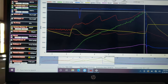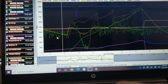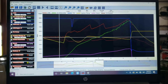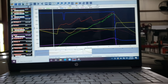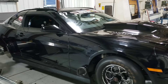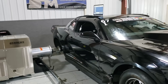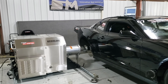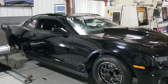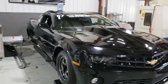We can look at dump valves, all that stuff. We were verifying our easy stage — it wasn't working, got it all working now. We're looking at charge pressure all through there, so we're able to do a ton when we do it on here, then start sorting the tune out to verify what we've already done. Super cool. If you're making big power, this is an excellent way to save a lot of time at the track figuring out stuff you simply cannot do on a tire dyno. Super happy with everything and look forward to doing more on our new Hub Dyno.